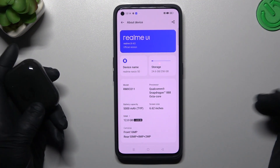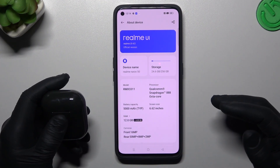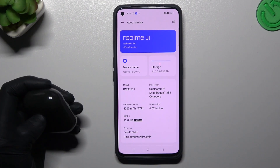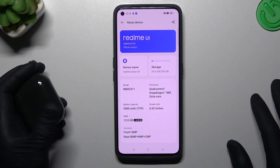And the last recommendation: check your Bluetooth accessory and your phone on another device with Bluetooth, like a laptop or another phone, to check which one is making the problem and which one is visible and which is not. And that's it.